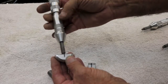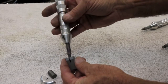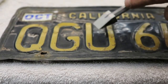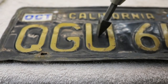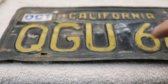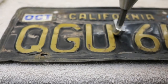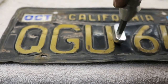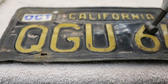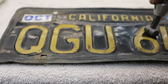The tool tip is designed to take different tool tips quickly and easily, making this tool versatile for many uses. It's as simple as that — just install the bit that you'd like to utilize to make your repairs. Let's take a close-up look using the hex head and applying pressure. We're able to remove the dings. We can roll the tool in the edges of the plate and you can actually see the plate moving.